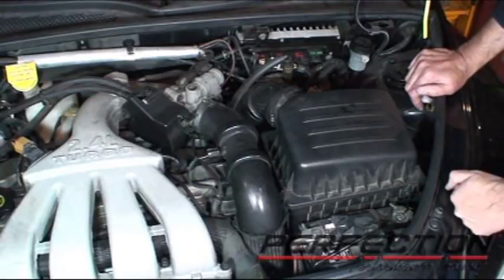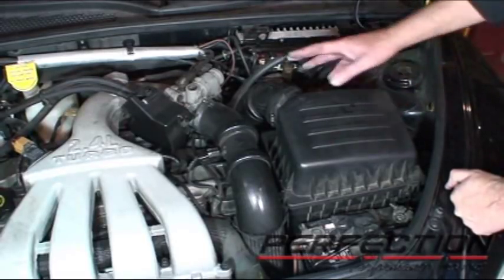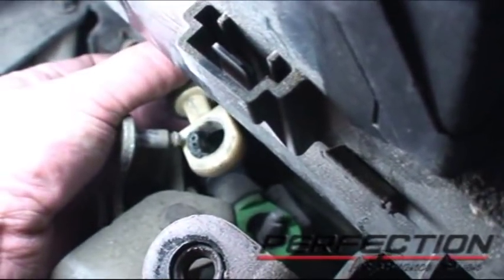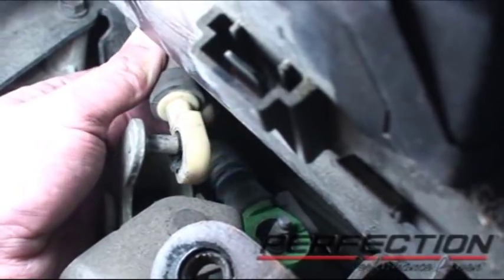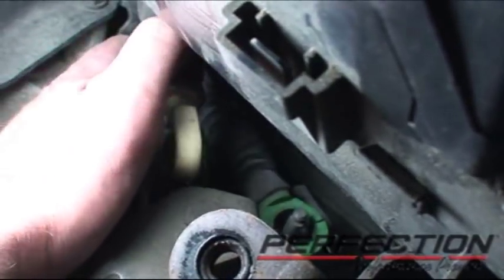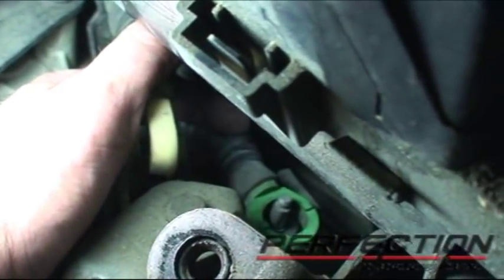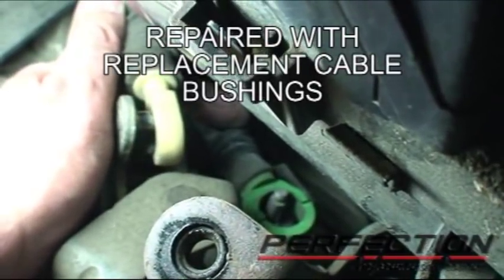This is just an overview of the engine compartment. The air cleaner, battery, and probably a few other things are going to have to come out. The battery tray and the entire air intake system will be put off to the side. There's the reservoir for the clutch hydraulic release system. During the test drive I noticed the shifter was a little bit loose — there's the pin and the remains of the bushing in the end of the cable. Moving the stick fore and aft, it's loose. The bottom one and the green one have nothing holding them onto the pin correctly. We've got to find a way to repair or replace these cables.